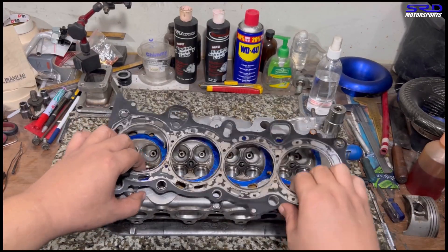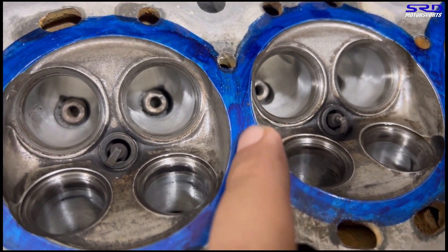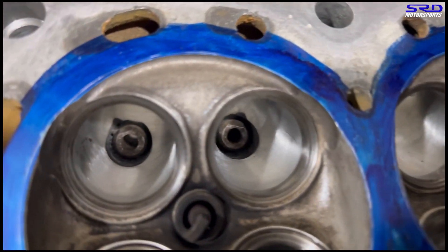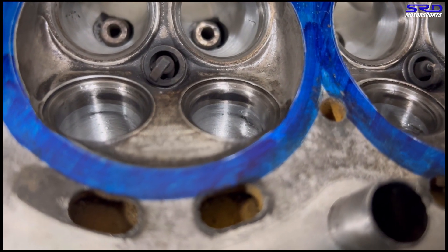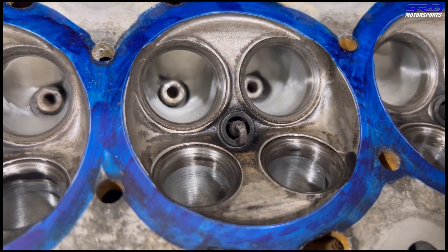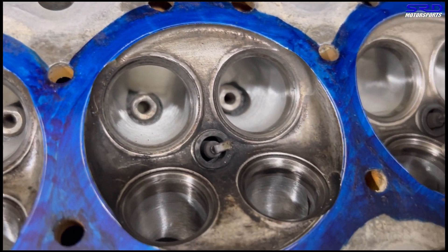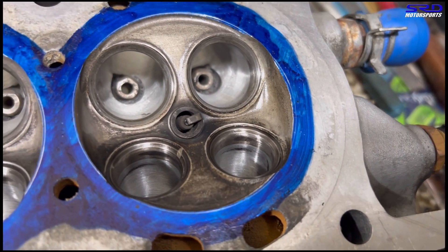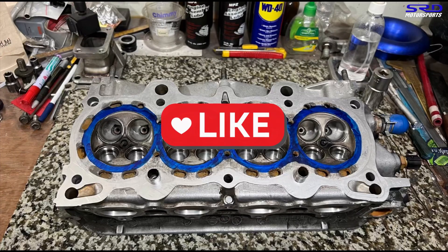After scribing a line on the chamber based on the head gasket and removing it, you can see it's slightly off to the left. Even on the intake side, it's way off. The machine shop will use the head gasket as a reference point so it'll be perfectly aligned to the bore when they're done. Number three is off everywhere — it's not just bigger, it's actually misaligned. Locally they call it counterbore, but in the US it's called fly cut. So we're going to have this fly cut by the machine shop. If this video is helpful, hit the like button — it generates activity and the algorithm will spread it to a wider audience.